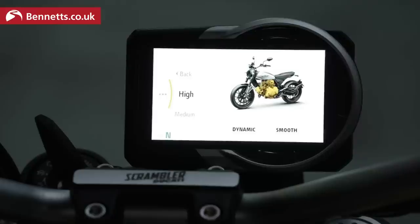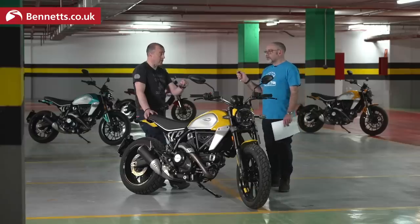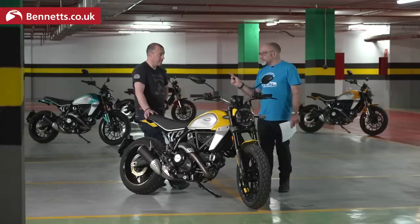Jump in if I make mistakes. Four plus off traction control settings. Two and three are auto selected by the rider modes. One and four then are selectable as well as off. And once you switch them off, it's saved. So if you switch off traction in one of the modes, and you switch it back on again, still off. I didn't try that, so that's great news.